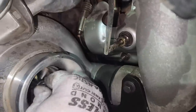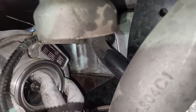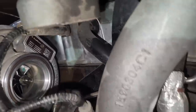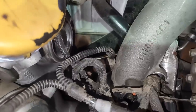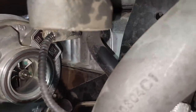Now, this is our turbo setup here. This is a compound turbo system. The lower one seems to be spinning fine. However, the upper one is basically locked - you can get it to turn a little bit, but that sucker is not free. At this point I would recommend replacing both turbos because obviously something's happened. Now these stupid spaghetti lines - these sixteenth-of-an-inch plastic hard lines are everywhere and they suck. You look at them and they just break off whatever they're connected to. They're a really bad design.